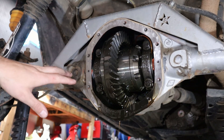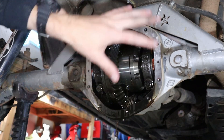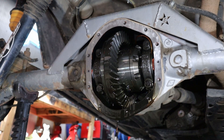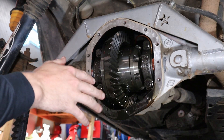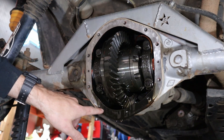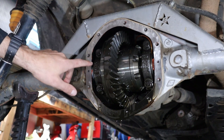I'm pretty surprised there was still much fluid in here, because a lot of it ended up coming out that axle tube. The way these Dana 44s work, the differential and pinion are slinging oil around, and there's a cavity that lets that oil drain down the axle tubes to lubricate the wheel bearings on the outer ends. As the Jeep tilts side to side, that oil drains back into the center. The problem is metal shavings from the broken bearing on the driver side started getting into the oil, which then flows back into the carrier. Looking closely, I can see really dark material in the oil and bright glitter — definitely metal shavings. The passenger axle tube had absolutely nothing in it, so fingers crossed that bearing got saved, but I still think the driver side bearing is probably cooked.